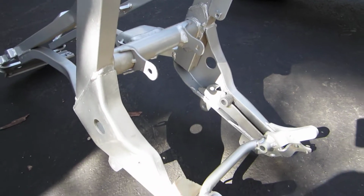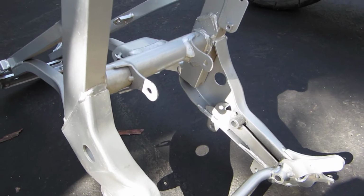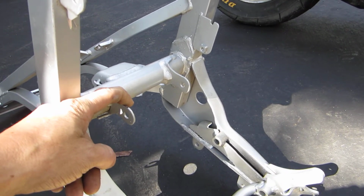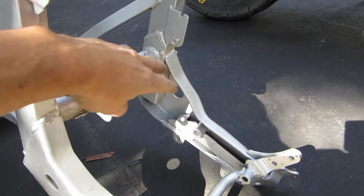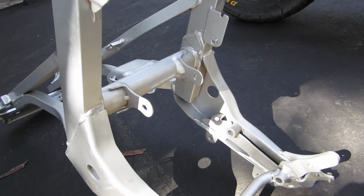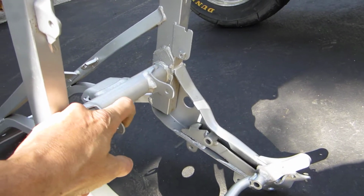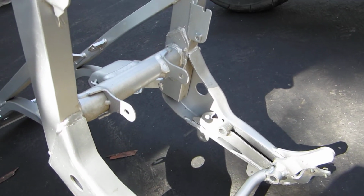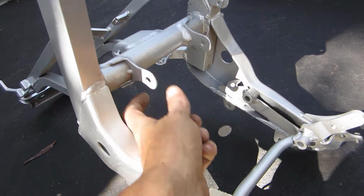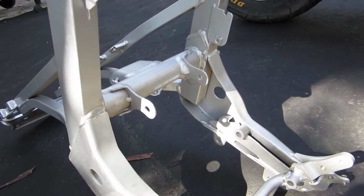The upper rear mount has to be reinforced. It's exactly a ½ inch wider than the RD boss, and this upper motor mount is what holds the little swivel pivot mount on the YSR. But basically, if you just add a 1/4 inch to this side and a 1/4 inch to this side, you can extend your mount to receive the upper rear engine mount of the RD.